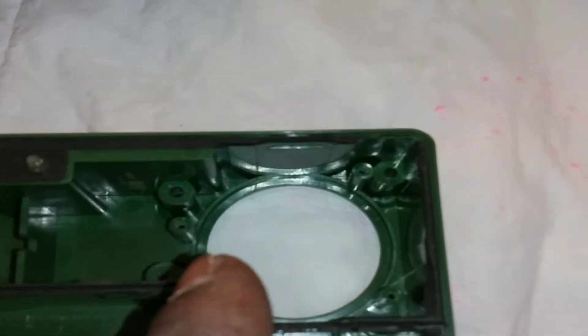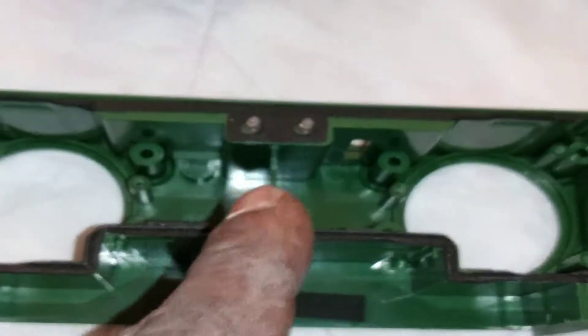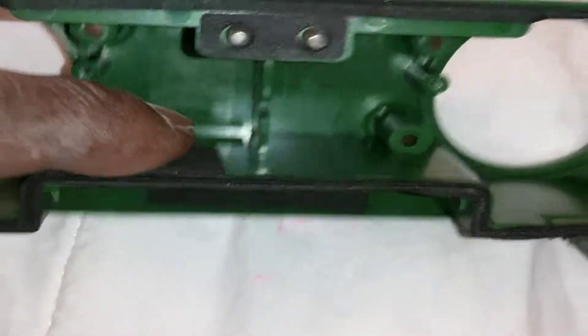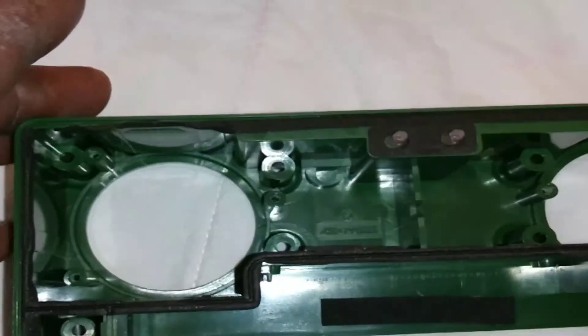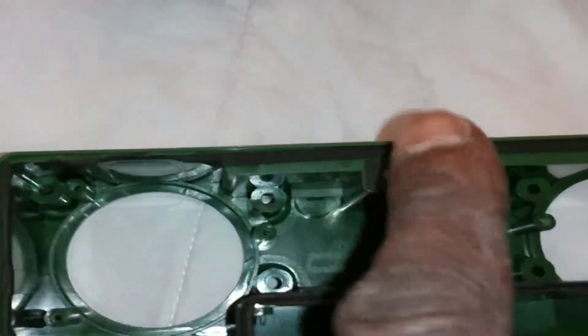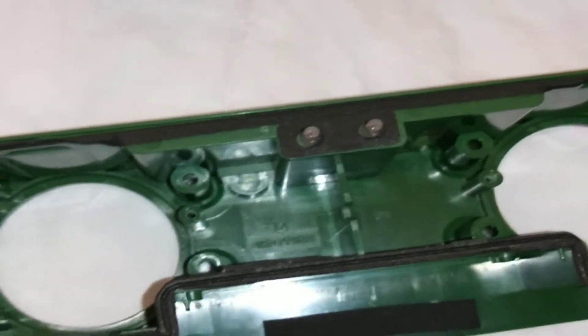What I'm going to do is get some kind of sealing or adhesive, put it on the inside and on these sides, seal all that up. There's another piece that goes in here that was wrapped around this cable. I'll put sealing all over there, seal this up, make sure the left and right sides are independent, seal it all the way around, then wait a couple of hours and do a sound test.